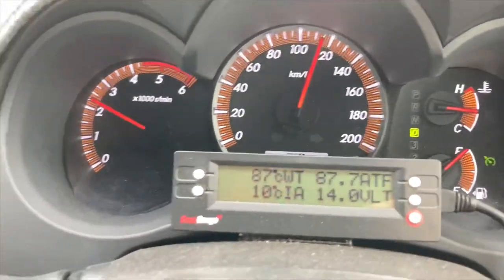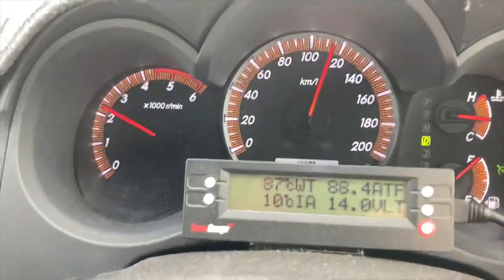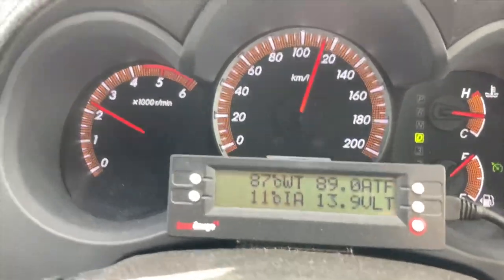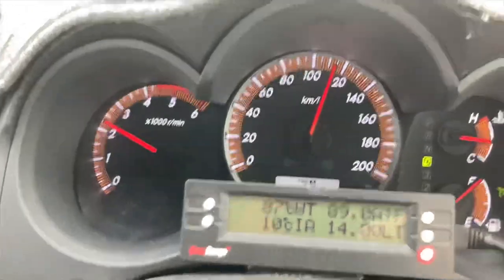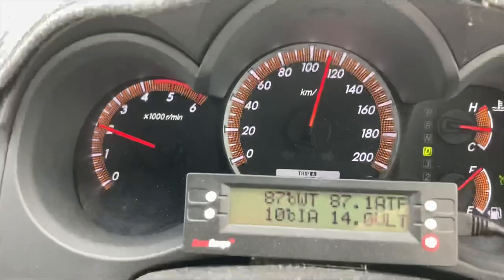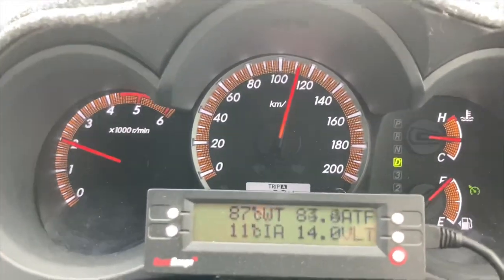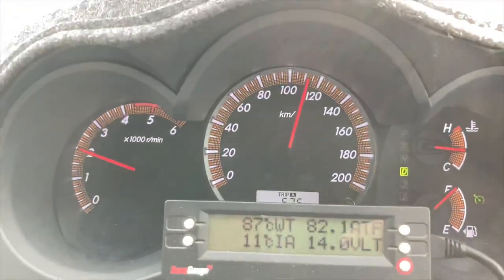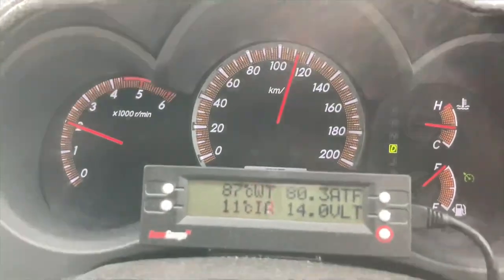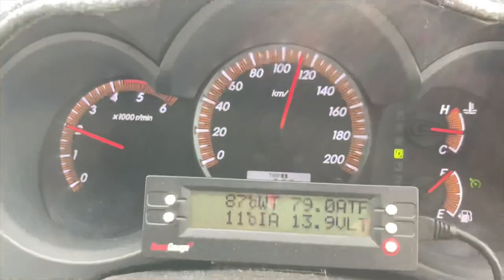We're up on the flat again, Kyneton turn-off, and we still haven't got torque converter lock even though it's flat ground. What I did on cruise control — I bumped it down one click. That reduced the load enough for it to lock the torque converter. We were probably one click a bit high anyway — we're only on 111, more like a genuine 110. We might have been speeding two kilometres an hour — there you go.